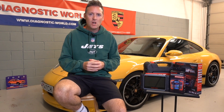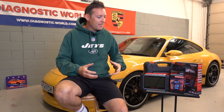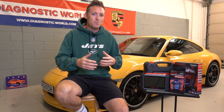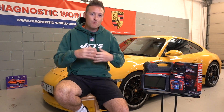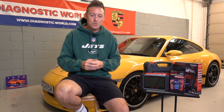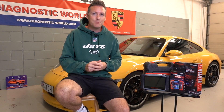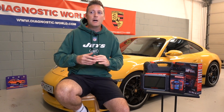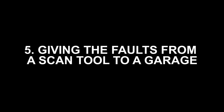Number four: it's quite common for people to think these tools are a magic pill. People think that if you've got a warning light — say an airbag warning light — you can just pick up one of these tools, go into the car, and simply reset it. That can be the case in some circumstances, but 99% of the time that's not how it works. The airbag light is on for a reason — there was a fault — and it doesn't matter whether you've got a £100 tool or a £10,000 tool: if there's still a problem with the car, the tool cannot remove the warning light. You'll need to fix the problem first. If the fault is intermittent, you may get away with clearing it, but it'll likely come back within a few months.